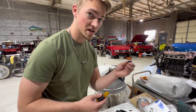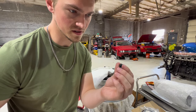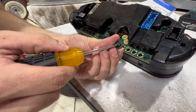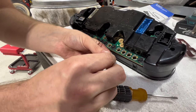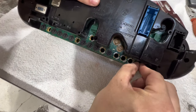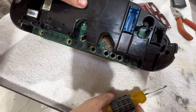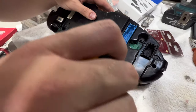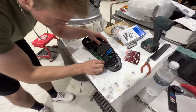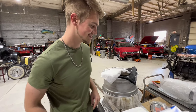I'll show you real quick how to replace one of the BMW indicator bulbs. They're a simple twist style but have a little slot you can use a small flathead in. Get the flathead in, then twist — and there you go, bulb replaced.